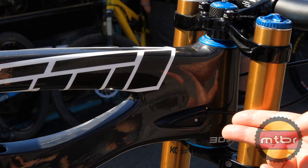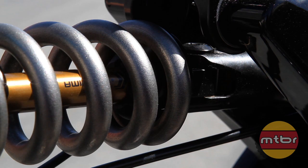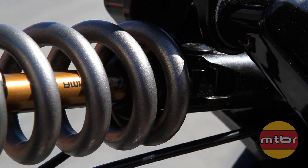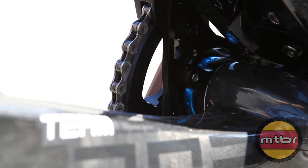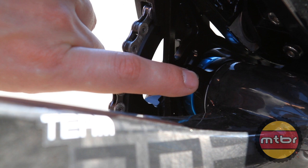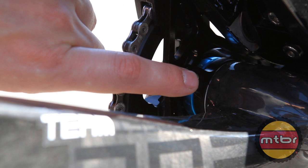Some of the features on this bike: right here is the integrated fork bumper and cable port. Right here is the exit port for the internal routing on the down tube. Here is the shock extender, which is extending the eye-to-eye length of the Fox RC4. Here is the vertical linear rail. Right here is the ISCG, and it's actually splined to the bottom bracket, so it's removable and replaceable. This is the internal routing port on the seat stay.